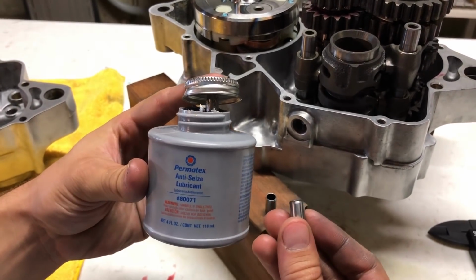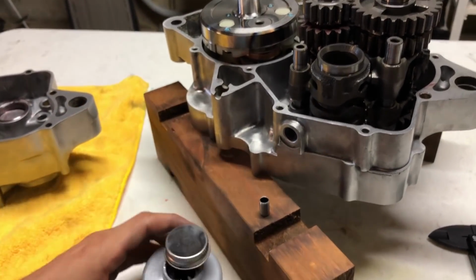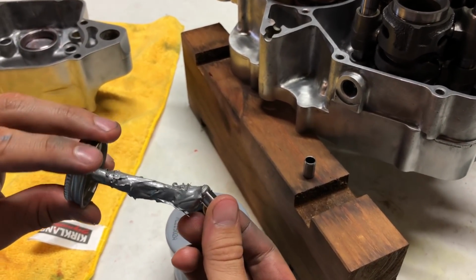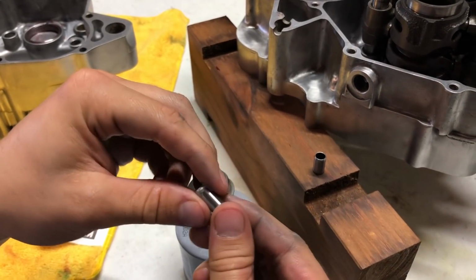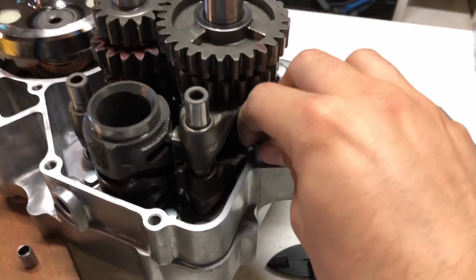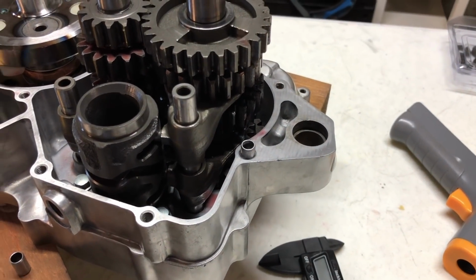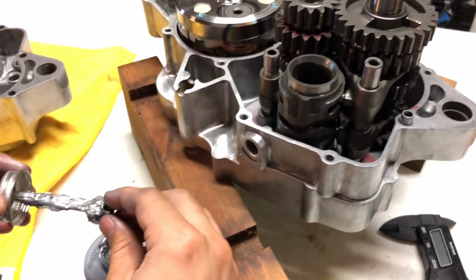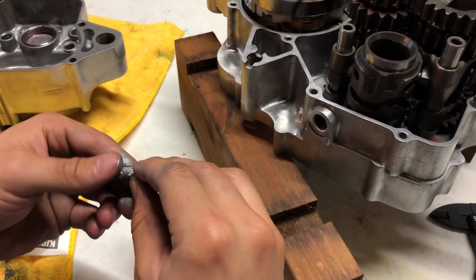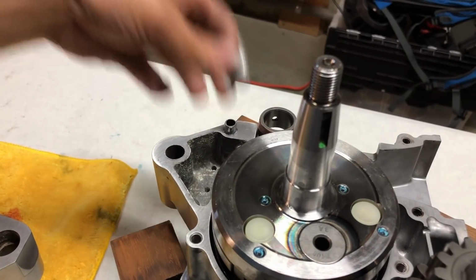Okay, we're gonna install the dowel pins now, and they're a common thing to rust and seize up, so we're gonna use some Permatex anti-seize lubricant. I will put this stuff down in the description as well as every other product that I've used throughout this assembly process. All right, after we put some anti-seize on this dowel pin, go ahead and pop it in there. Put some more on the other one. Work it around on there. Pop it in.